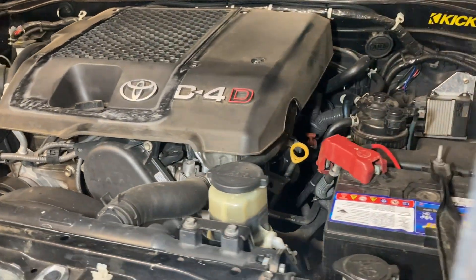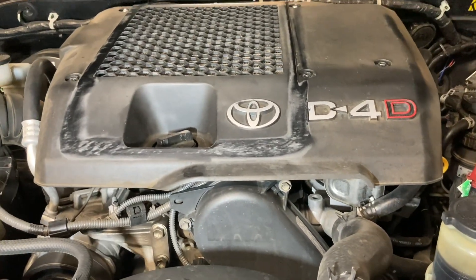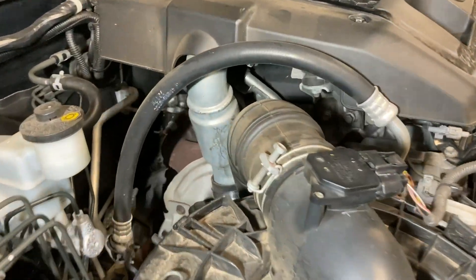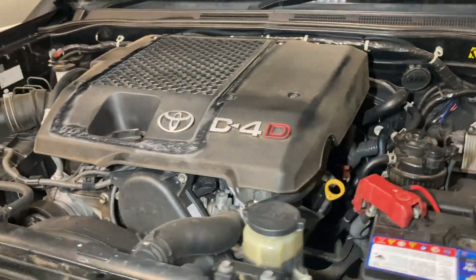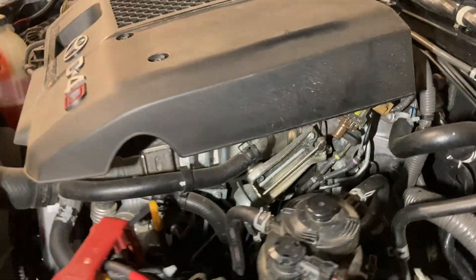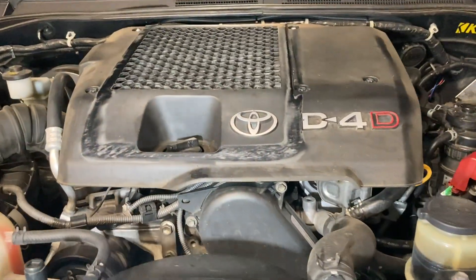What I'd recommend is the injectors come out. It's pretty clean but needs a really good clean-up first - injectors have got to come out to prevent contamination - and then we check the dates on the injectors. We just don't necessarily trust the workmanship. If they can't even put a clamp on straight and we haven't even got the plastic cover or the intercooler off yet, you've got to think this through. There's a bit of oil on the valve cover so it may need some RTV or it might be cracked - not a big leak, more of a weep.